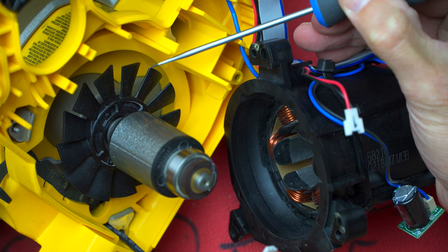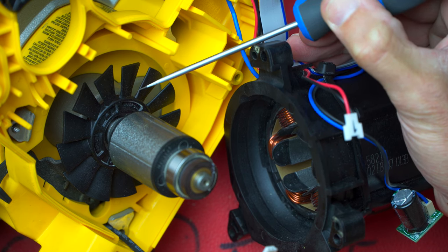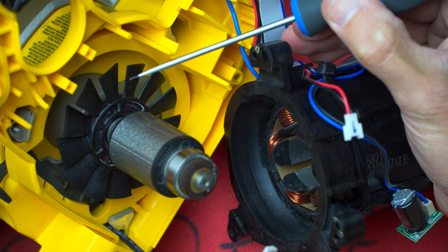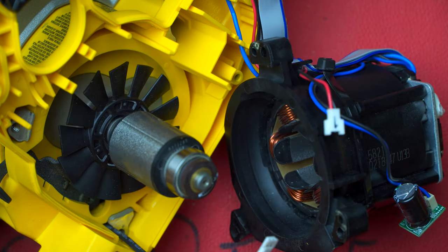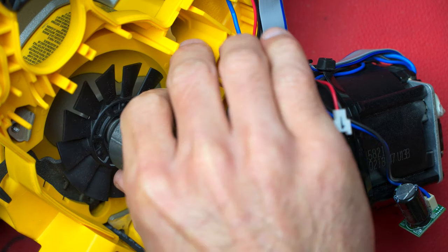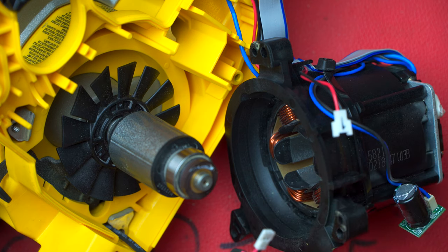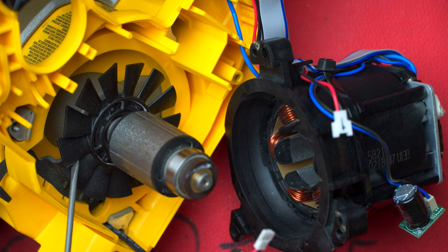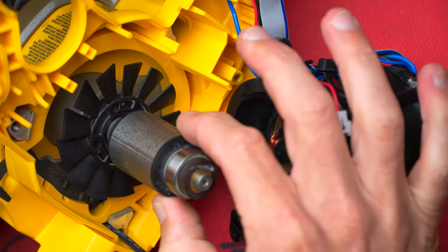The little fan is quite cute — also a nylon PA66 with glass fiber reinforcing at 33 percent, which is quite strange as you normally see 20, 25 or 30 percent. Not a bad little unit. As for the bearing, I can't really get this out — I think you would have to pull this section off — so I can't see what type of bearing is in the front of the housing. I'm guessing it's going to be something the same as the bearing at the top.